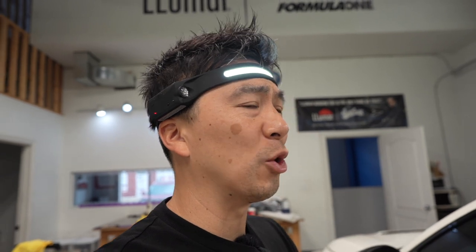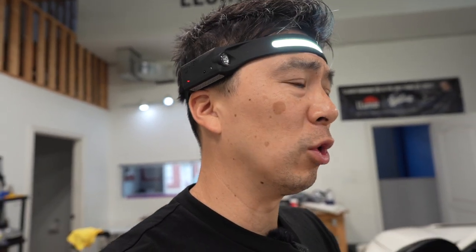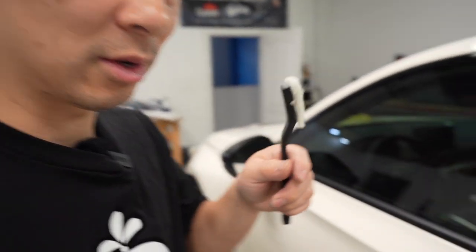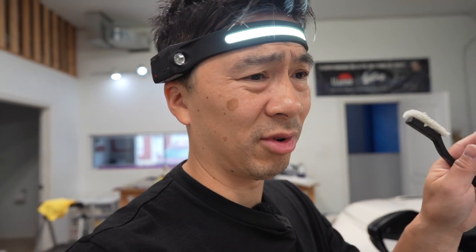It is a paint protection film. The only thing is, I don't like putting it on roofs and areas that are highly contoured, because it has limitations — you'll start to see little breaks in the black, and it looks really ugly. So I wouldn't recommend putting it on that kind of stuff. But for these flat trims, yes, highly recommended. Vinyl can't do this — it doesn't protect, it will just chip up. This stuff will protect for sure.